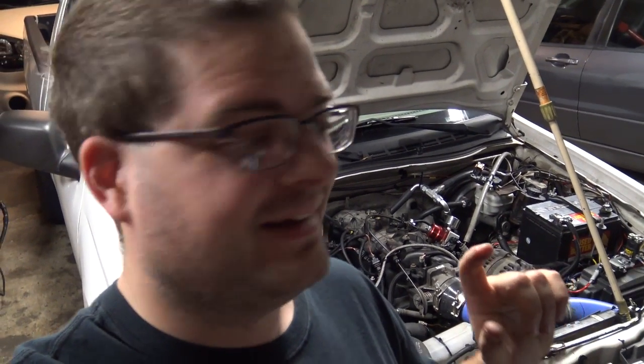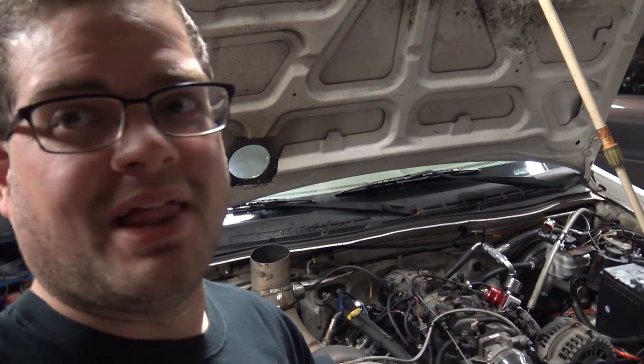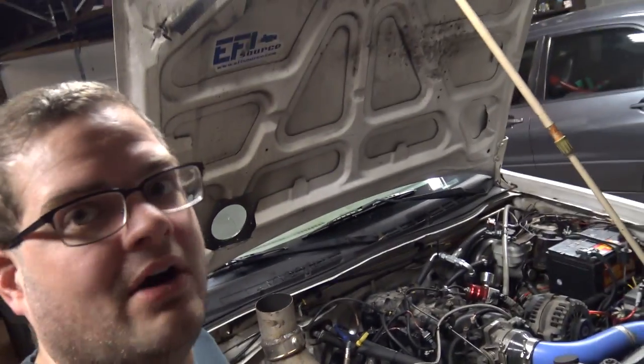Okay, this is where it gets all convoluted, and I'm probably going to have questions on this video about stuff I already stated. I know right away there's going to be issues, but we'll try to cover this as best as we can. So the truck - I got to the dyno, first blast, nailed down 750 on like 13 pounds, and not much ignition, less than I had before because I took that 5-degree offset out.